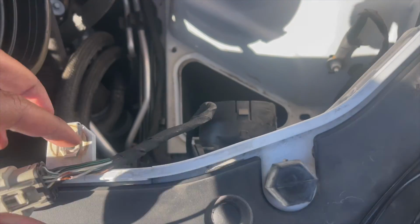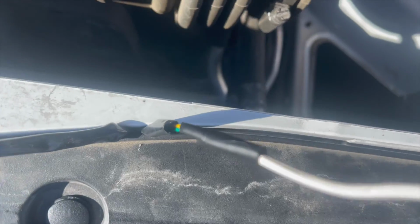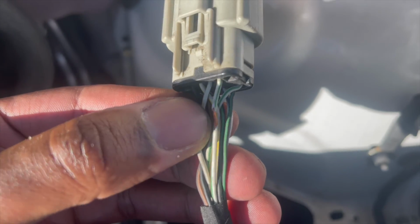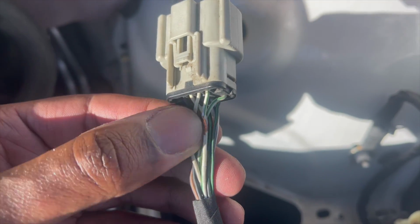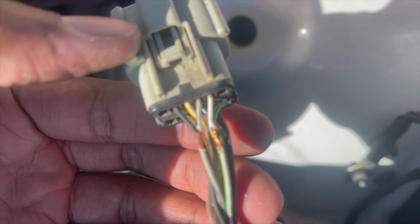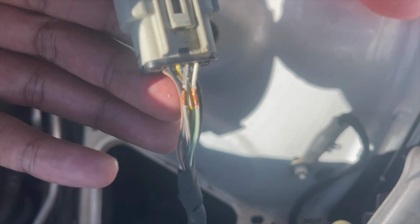All right, C fam, so moving on to your headlight. Your yellow and green wire, this one right here with your extension, is gonna go with your green and white right here. So literally green and yellow goes in green and white. Hopefully y'all understand that. Then your red one, which is your power, should go into the white and brown one, literally right next to it, y'all. So red goes into the white and brown, or white and black, right next to it.